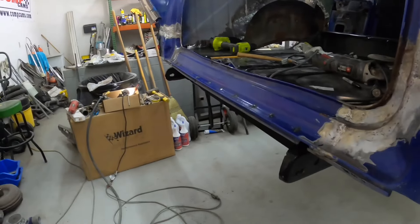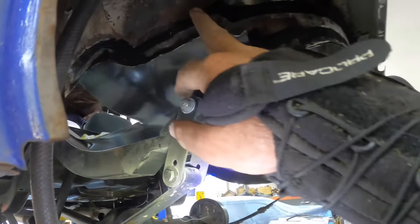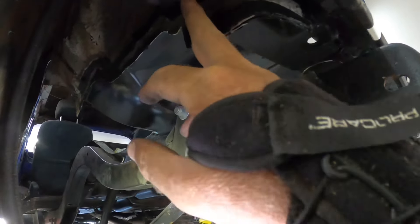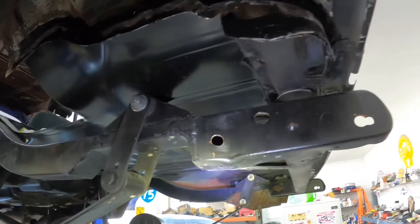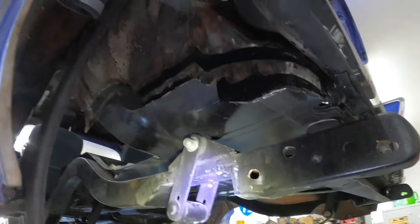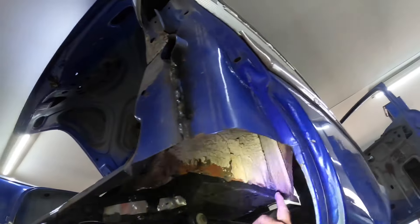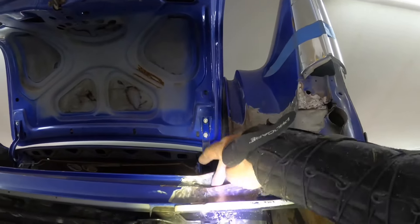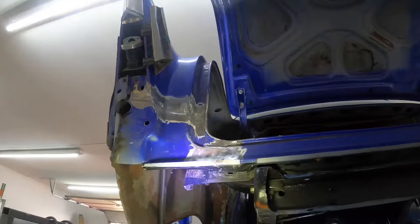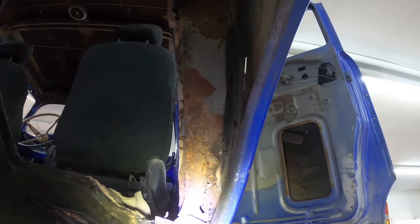I'll lift it up. As you can see, I built all the bottom from here - it comes across to here and wraps around to here. Had to drop all this area back down where it was - it was all rusted away. Made it from that section all the way across there. Wherever you see that black line is where I made that inner quarter panel - that came up good. Same with this side - put a section in there and made all this section up. It goes all the way and wraps up to here, gets spot welded up in here. So that's all done. Next thing is these dog leg sections - it's necessary to get that done now.